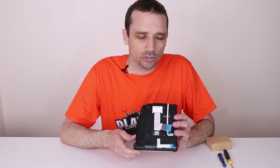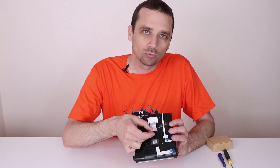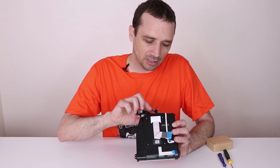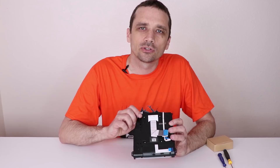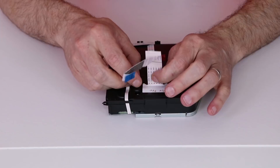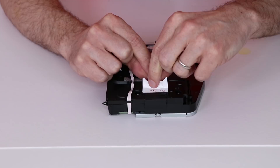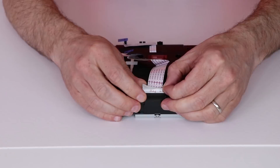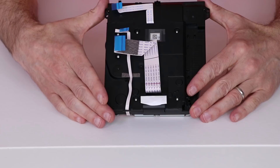This is how the disk drive will look when you get it removed. What I always do is draw a line on the sticker right here so I can see where it goes on this ribbon cable, because once we remove the sticker the ribbon cable will be able to move back and forth. We need to get it back in about the same place or there may not be enough play for the laser to move. I just draw a line with a Sharpie, then remove the sticker — pull up on the ribbon cable to loosen it, pull the sticker back carefully, roll it under itself, and stick it back to the top case so it's out of the way but still there for reinstallation.